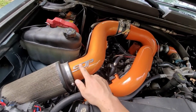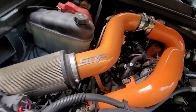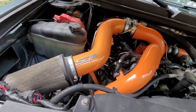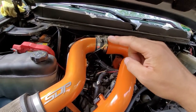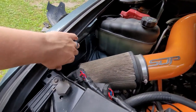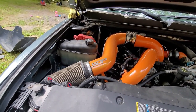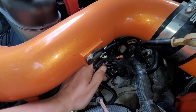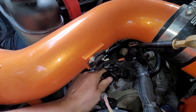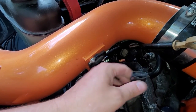While it's draining, I'm going to take the intake off. These bolts right here are 7/16ths, they come right out. If you have an aftermarket one, most likely you'll have a 12mm bolt down there and the whole thing comes right out. If you have the factory one, it'll be 7/16ths up here as well. The whole thing will maneuver out — you'll pull up the air dam and it comes right out. Then pull your sensor out of the intake — just push it down and it pulls right out.